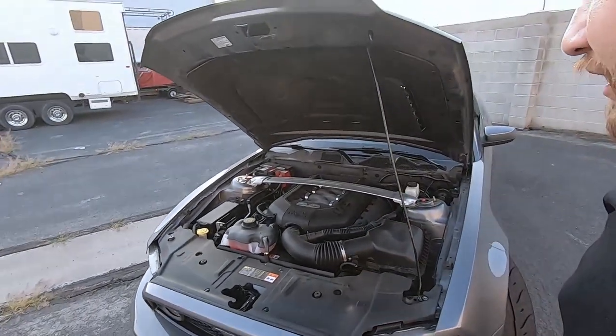The reason I got a 2014 — the second generation of the S197 — is that engine. That right there is the 5-liter Coyote engine putting out 420 horsepower. In 2010 they changed it and put this engine in. The one before was a 4.6-liter that put out 300 horsepower — probably the most gutless engine I've ever driven in a Mustang. You have to put a lot of money in those just to reach the stock power levels of these. That engine alone is why I'd say get a 2010–2014 if you're looking at S197.